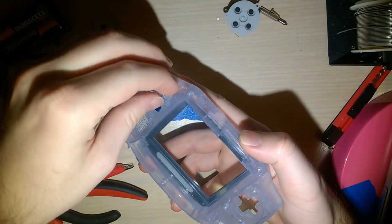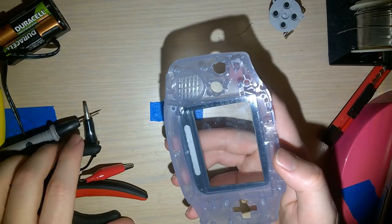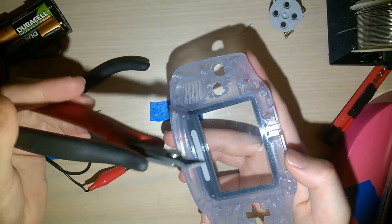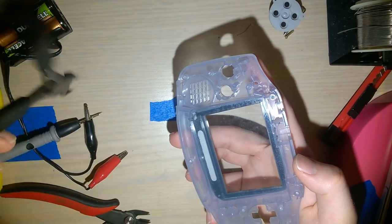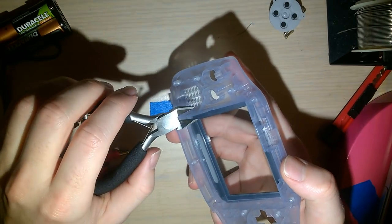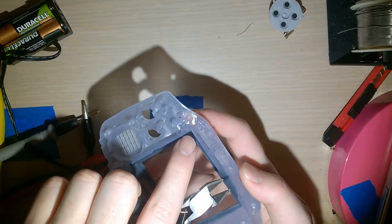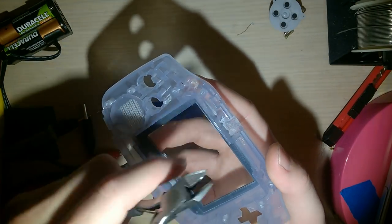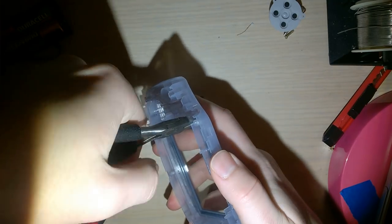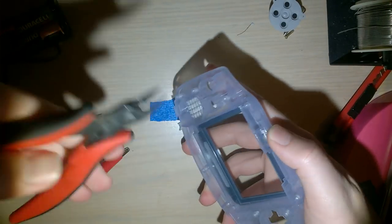So for this thing in particular, I'm gonna take out the LED light pipe. Before I lose it, I'll push it to the side so I don't forget to install it later and complain about it. How I'm going to remove this whole wall here, I'm going to take my flush cutters. I actually bought a cheaper pair, because I keep using this pair for stuff like this and I don't want to break my nice pair. But in this case, I don't know if this one's going to fit. I'm going to stick this in between, there's a little support for the screw. I'm going to stick it to the left of that on the top wall. Yeah, it's not working. We're going to use the other one. Same place, squeeze. That's it.